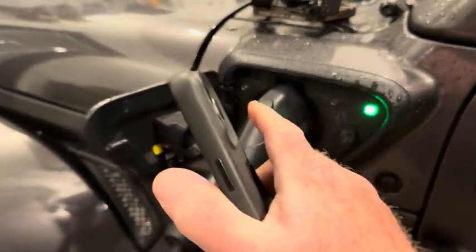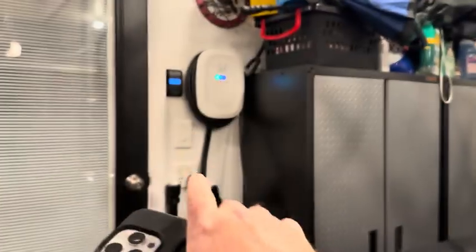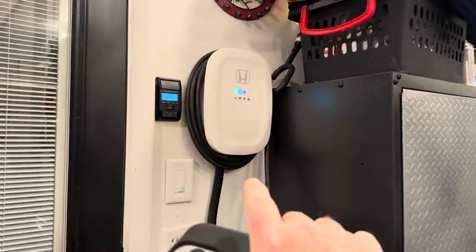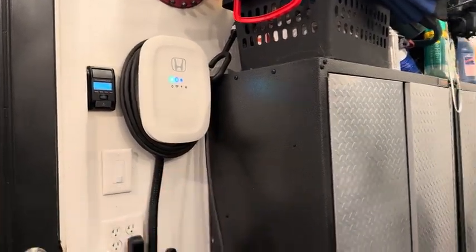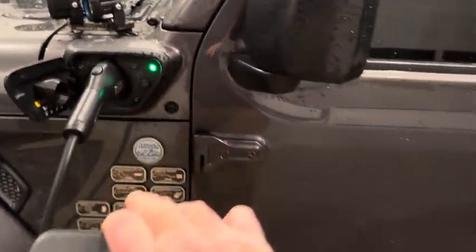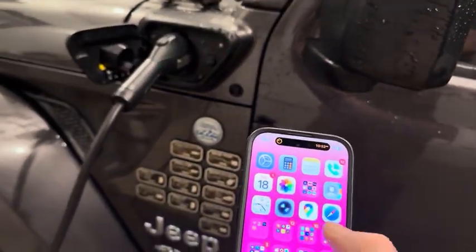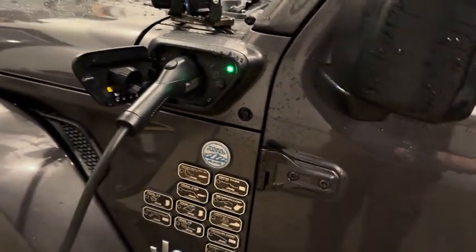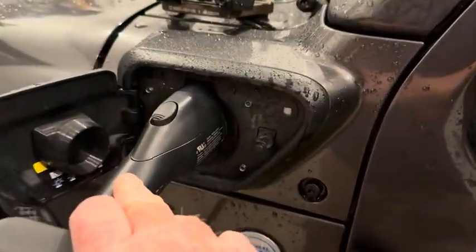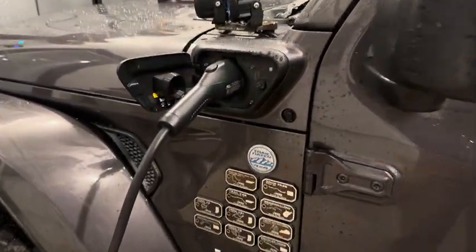You're not going to overcharge this thing, because the EVSE doesn't push current. All the EVSE does is make voltage available — it just makes power available to the vehicle. The vehicle determines how much it's going to pull. So I just wanted to put that to rest for anybody who is concerned about that. You can never push too much power, because the vehicle pulls — the EVSE does not push. Hope that answers some questions. Thanks for watching.